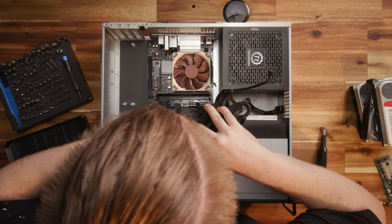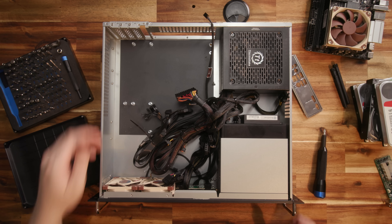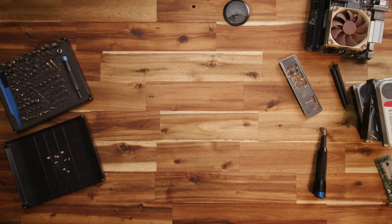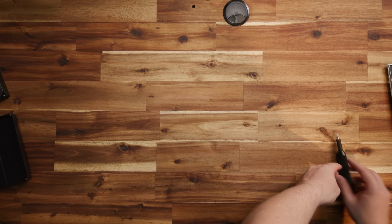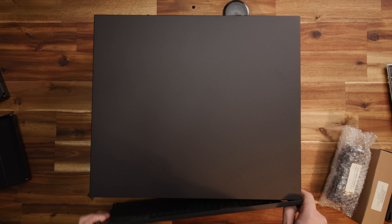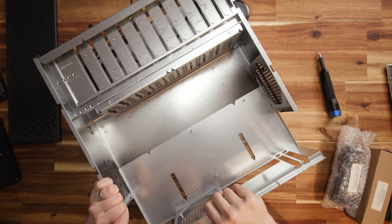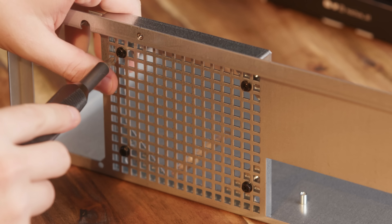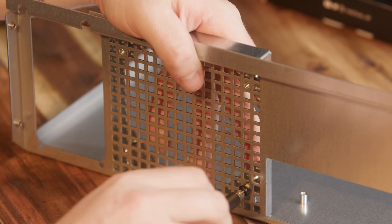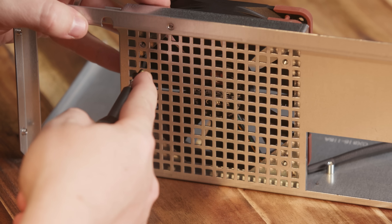This isn't going to be a fancy brand new server build — this ain't no petabyte project. I'm just using this upgrade as a pretext to talk about how good of an investment this server's been for me, and to show a little bit of this case for anyone who might be interested in their own. After shutting down and stripping the original Bragi, I was ready to get cracking. The Sliger case comes apart behind the drive bays to make it easier to install your hardware — in a small enclosure like this, features like that are a godsend. I went with some of Noctua's industrial fans. The rack's in my garage so noise isn't a concern, but heat is. These fans move some serious air, which should help with drive longevity.